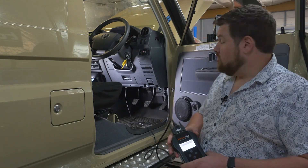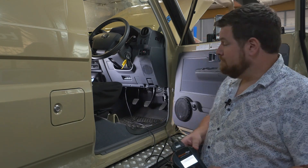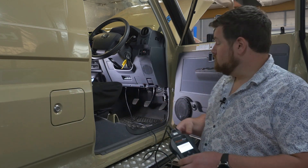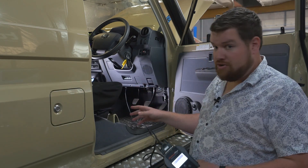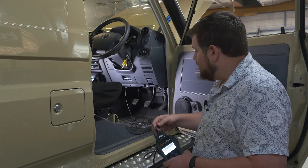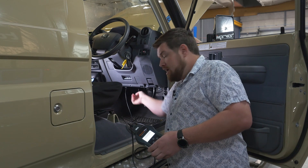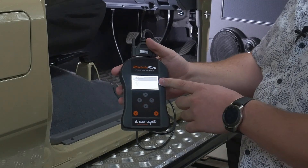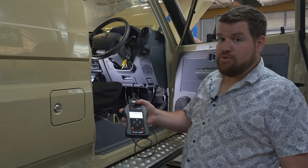So we're in the process of doing a read with the module map remote tuner. The next step in the process is to locate your OBD2 port. The standard place for these to be fitted in your vehicle is in the driver's side footwell, usually up underneath your dash. In the 78 series, it's up underneath here. Once you connect the OBD2 port, your module map should light up into the main menu and we can begin the read process.